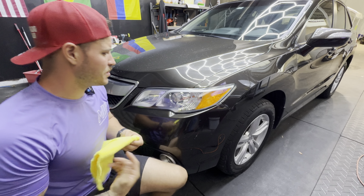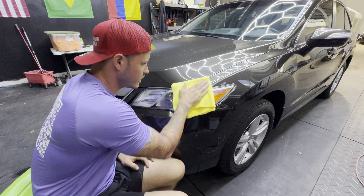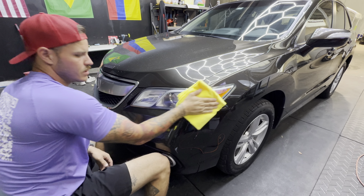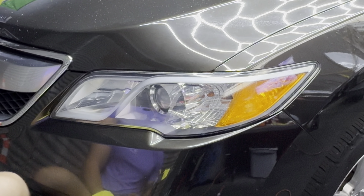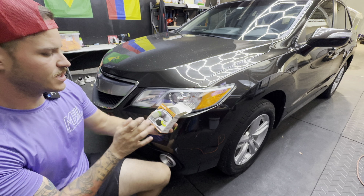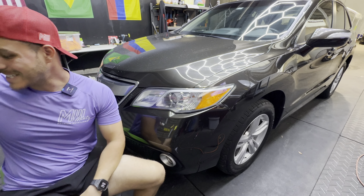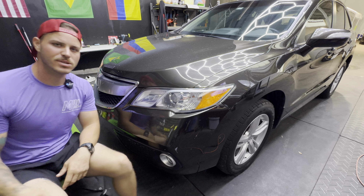There's not really a cure time to watch — once you've coated the area and feel comfortable, grab your clean rag and wipe it off. Do one full wipe with one side of the towel, then flip it and give it another nice wipe — it might feel a little staticky. Wipe down all your surrounding panels too so you don't leave any coating residue. That's it: Extreme Nano to protect, 2K and 3K wet sand discs to clear the oxidation, and step one compound for the polishing and refinement. Appreciate you guys listening — I try to drop some knowledge, and if I can help, that's what I'm here for.